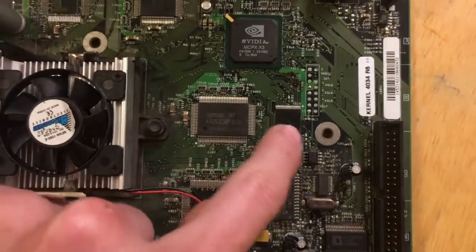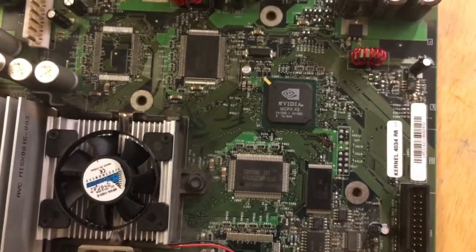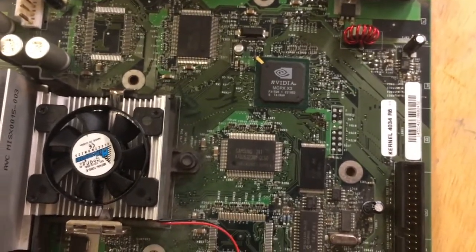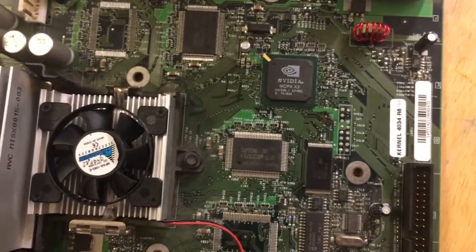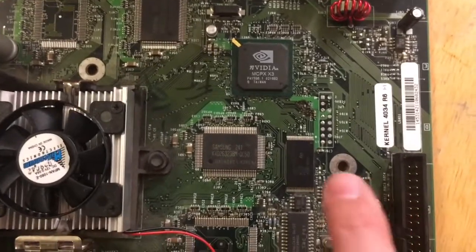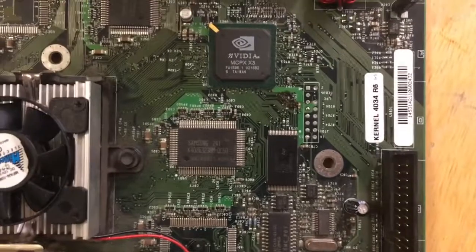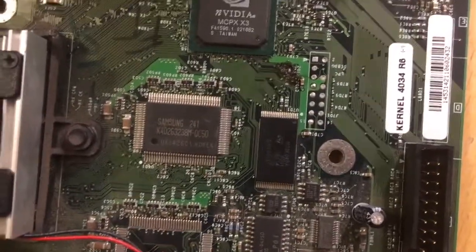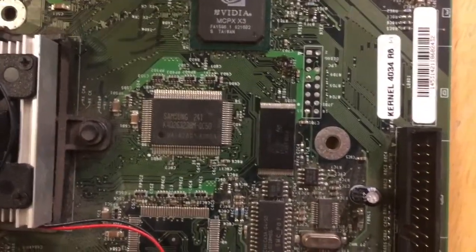This one right here, I believe, is 1 megabyte. They were 1 megabyte on the 1.0 and 1.1 model Xboxes, and then a smaller amount, I think 256 or 512 kilobytes on the 1.2 to 1.5 revision Xboxes. And this is just where the BIOS is stored. So we want to be able to flash that with a custom BIOS, so we can do things like install a larger hard drive, for example. It's necessary to do this. You can't just do it with it being soft modded.